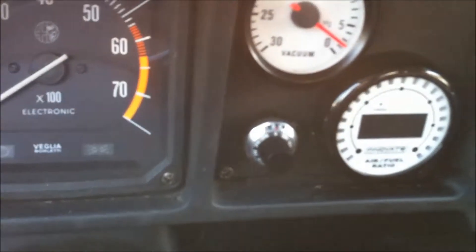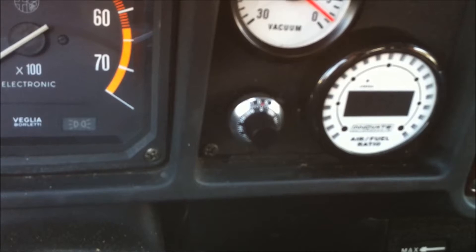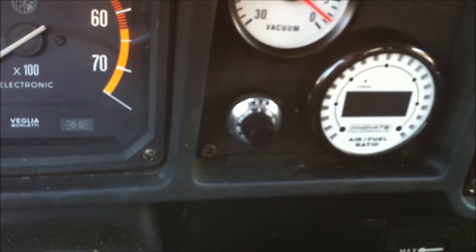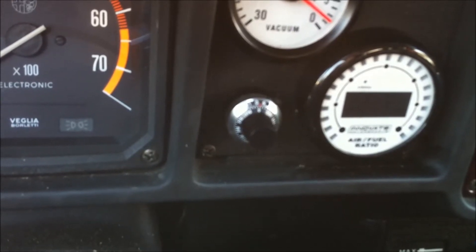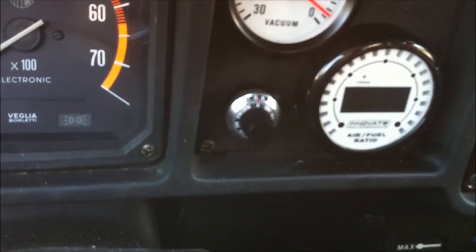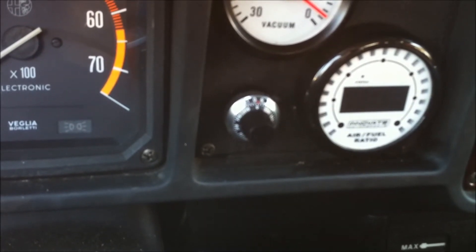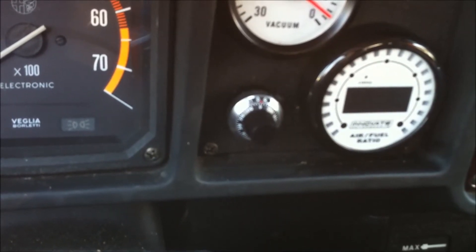This is the new control head for our new black box fuel control unit. It's a very effective way of adding fuel delivery with old Bosch L-Jetronic cars or certain older Motronic cars. Pretty much any 80s car with electronic fuel injection, this device is going to work. It increases injector duration to add fuel, and that enables you to retain the old fuel injection system even with pretty significant mods like compression cams, and to a certain point even with aftermarket turbocharging and supercharging modifications.